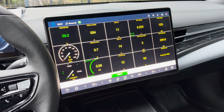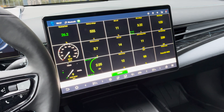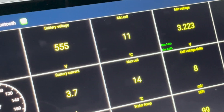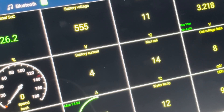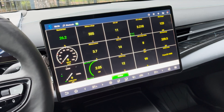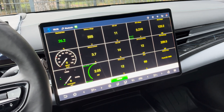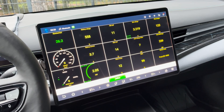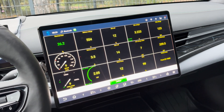We have been preheating the battery for exactly one hour. The maximum cell temperature is up to 14 degrees, which is decent, but I would have hoped to see at least 15. The biggest problem is that the minimum cell temperature is 3 degrees below the maximum cell temperature — this is important because to get the best charging power these temperatures need to be quite close to each other. My expectation was that both figures would have been 15 degrees or more. 11 degrees minimum cell temperature after one hour of preheating is not much, and it's not even winter yet. At 61 minutes it's now 12 and 14.